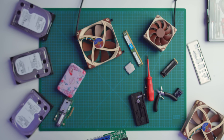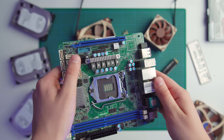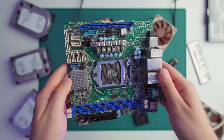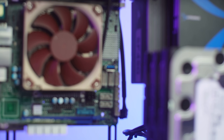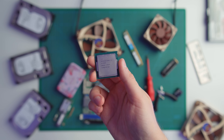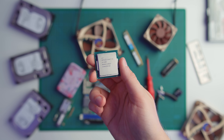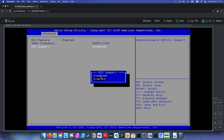This is the Asrock C236 WSI — an Intel Skylake Mini-ITX workstation motherboard with 8 SATA ports that supports DDR4 ECC memory. It's an old motherboard and still pretty expensive even today. I bought it used for 185 euros, which is about 210 bucks — a lot of money for a used Skylake board, but it's pretty much the only Mini-ITX motherboard in this price range with that many SATA ports. I paired it with an Intel Core i3-6100, and even though it's a pretty old CPU, the performance is still more than enough for home server tasks. The i3 Skylake CPUs do support ECC memory just fine — you don't need a Xeon for that.